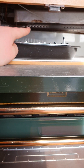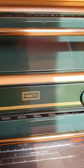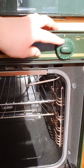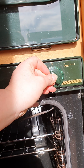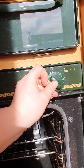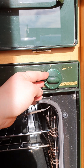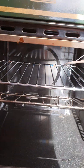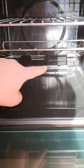This here is your grill — it'll ignite along the rod down the middle. Your oven has its own control here: push, turn, and hold at the temperature you'd like, then hit the igniter on the top of the oven — it operates the whole oven-grill-element system. Release, adjust your temperature, and back to the circle for off. Your oven will ignite just along the back behind that small rail piece.